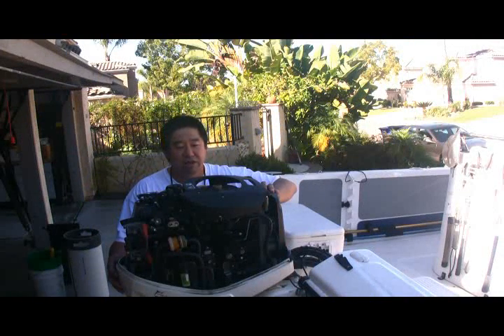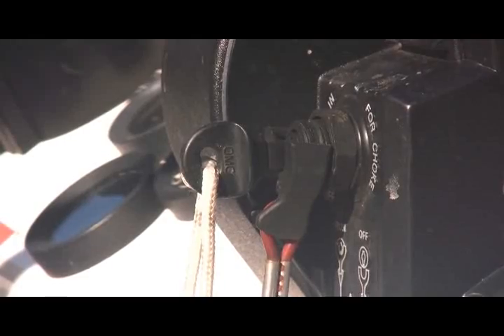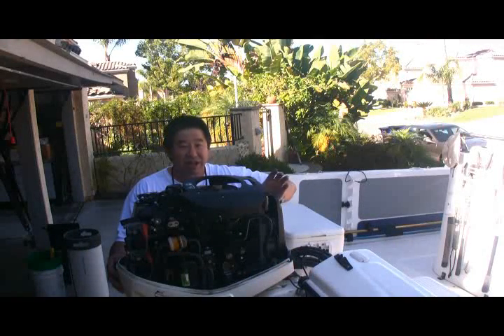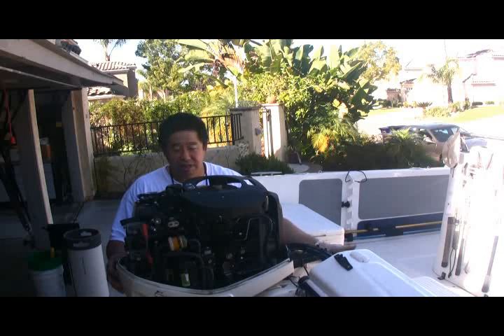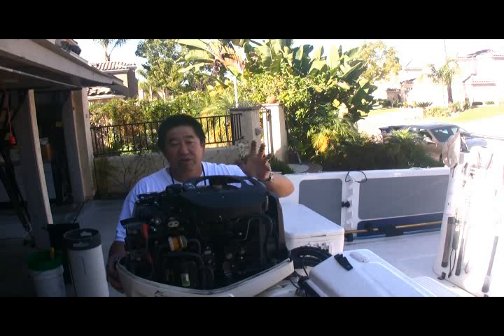Okay, we've got the rope finished and we're just about ready to give it a try. There are three other things we've got to do. The first and most important is you need to make sure the ignition is turned on. The last couple of times I tried, I forgot to turn the key on — I don't know why I thought the engine would run with the ignition off. So this time I'm going to make sure the ignition is on. You also have to make sure you have plenty of fuel — I've got the fuel bulb pumped up and ready to go. And since I'm doing this in the driveway, I need a source of cooling water, so I've got my garden hose ready to attach.